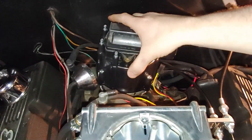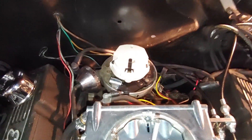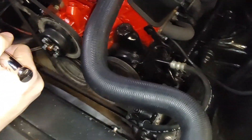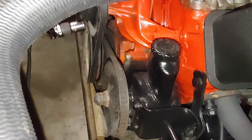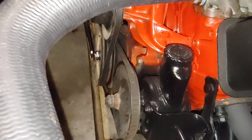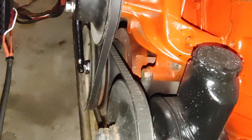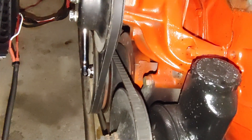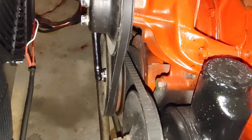Now we can take the cap off. Now we have to take our breaker bar and put the engine on 10 degrees before top dead center. We're on zero right now, and you can see there's 8 and 12 — we want to hit between those, right around 10. So we go back and put it on 10 degrees before top dead center. That is about perfect — 10 degrees before top dead center, and that is what the distributor calls for.